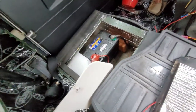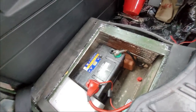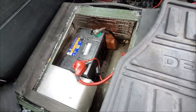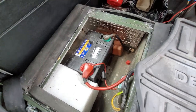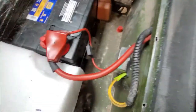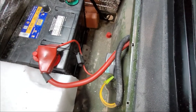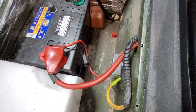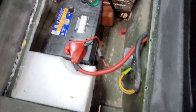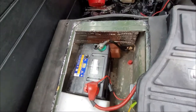That's my battery box for the time being. Archie gave me a really cool picture of his setup. There's plenty of room in here for two batteries — a lot of room. So I'm going to go ahead and get the dual battery system. This battery currently has two leads that go directly to two relays — for the engine fan and for the AC condenser fan. Once I get the two-battery system I just got to find the right setup. Just got two pieces of wood in there to keep it from bouncing around and a hard piece of foam.